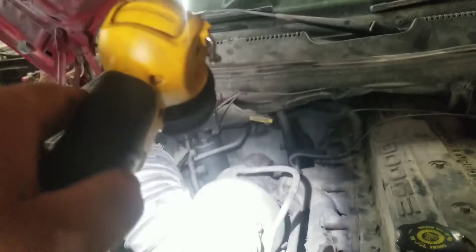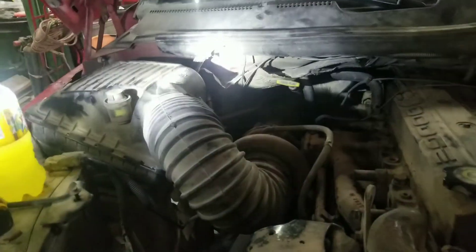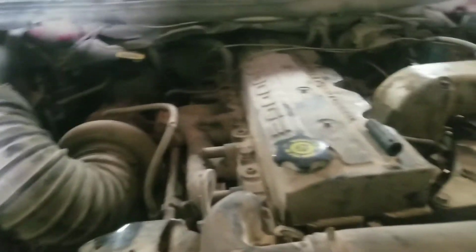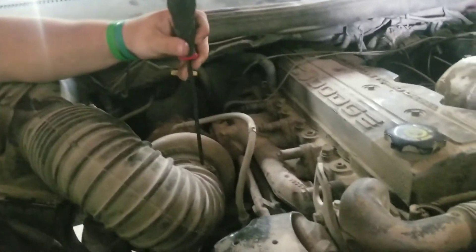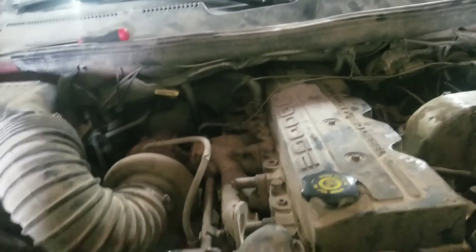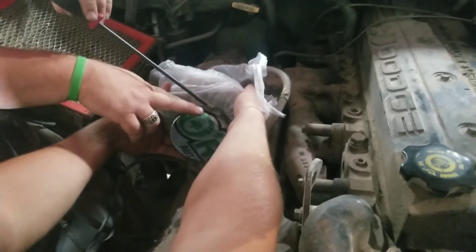Now here's what we're going to do. We're going to take our intake tube off of the turbo and put something over the top of that, because if we just start blowing air in through that little port we just made, it's going to push all that air all the way back around through the intercooler and back out the turbo into the air box. So we've got to block that off somehow. Usually what I do is take the air box lid off, put something across that, put the bigger hose clamp back on top of there, and that usually gives you enough of a seal. Now we're installing our parts-store plastic sack.